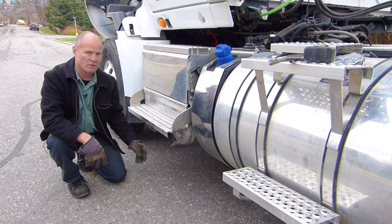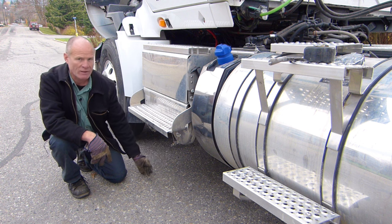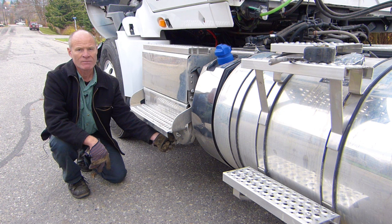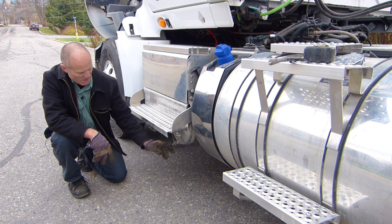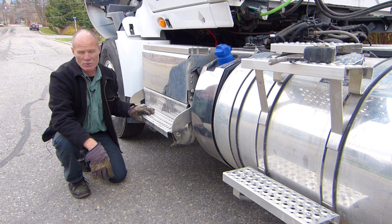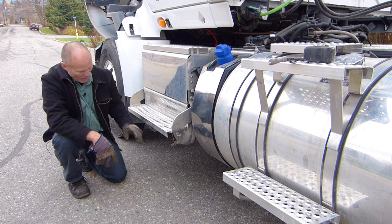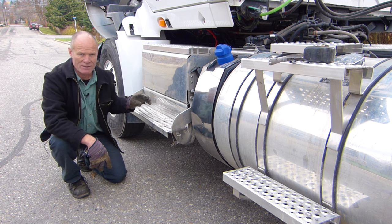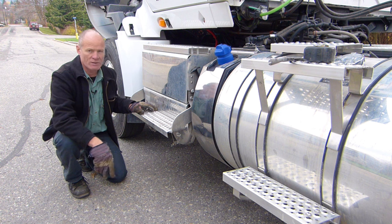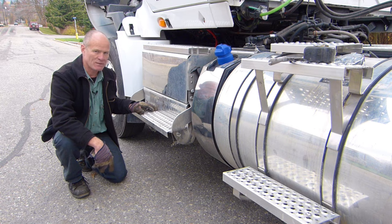To check the air tanks on the ADIS system, you just have a primary and secondary tank — secure, not damaged, not leaking. You're listening for audible air leaks and making sure that the drain valves are working. You can see there isn't any moisture or other contaminants coming out. Filter technology is really good on these newer units and has improved vastly in the last decade, and the air dryer is incredibly effective at ridding the air of moisture and other contaminants. On most newer vehicles you're going to have an ADIS system.